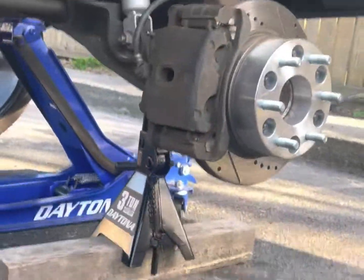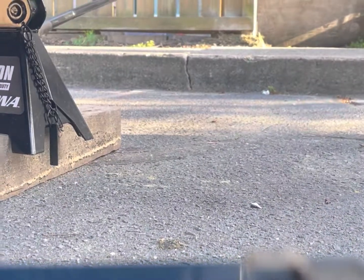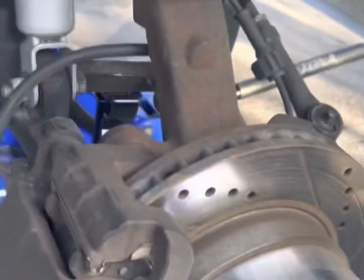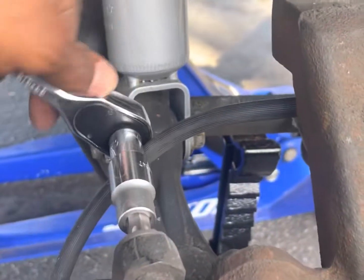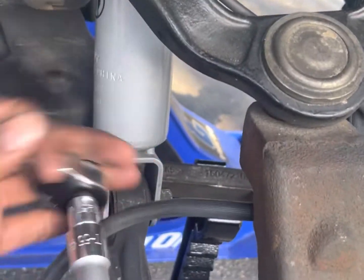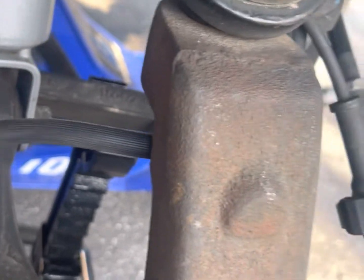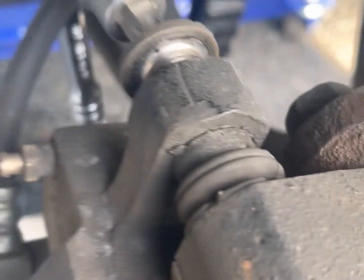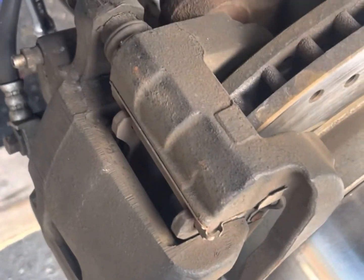Slide up on this side so I can see you on the side. Let me see what's up. How about if I just keep y'all with me? Right is tight, left is loose. So if you ever have a problem and this starts moving, get a pair of pliers and just hold it right there, and then you just untighten it. Should be good though.